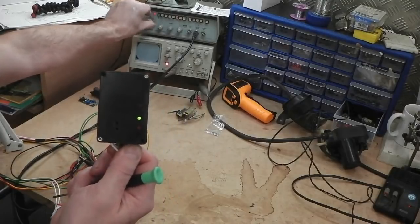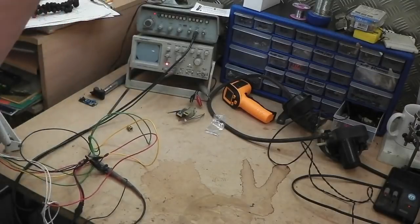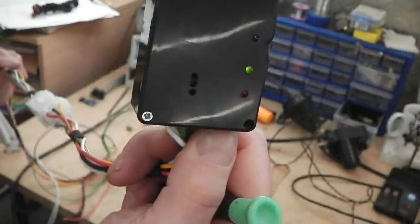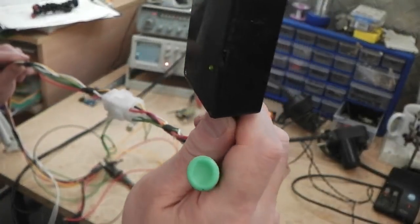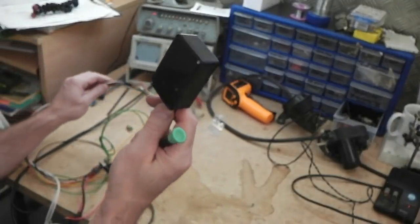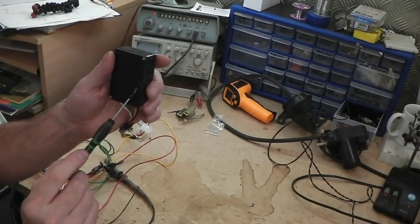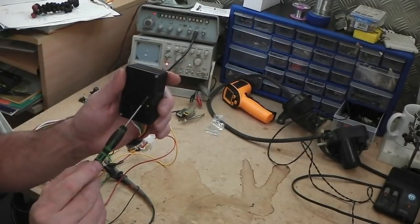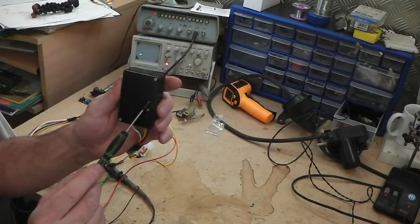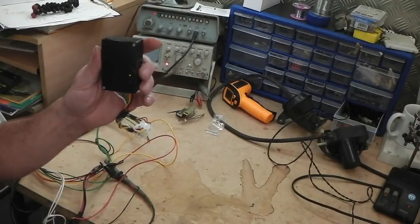Can you see a slow blink? Let's bring you up. I'll have to hook around the lamp. Bring you right in so you can see. We've got a flashing red light showing the pulses of the road. That's effectively the shaft spinning round on the auto box. A green light there, that's what's called the safety light. Green's on, and the system's offline. Then above it is another red light, which would indicate a torque converter lockup. So that red light connects to the actual main relay outside of this box, which can be fitted behind the dash.